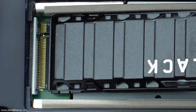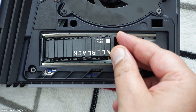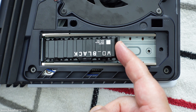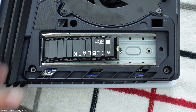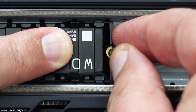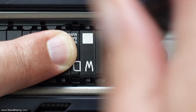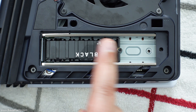Feed the SSD into the slot where the M.2 is and at some point you will feel it grip itself. Push it a little bit and you'll hear a slight click. If you let go of the SSD it will hold itself in place and become a bit springy — at this point the SSD is connected to the M.2 slot. Push down the SSD at the back, put the screw back into the spacer, and fasten it down tightly over the back of the SSD so it sits on top of the spacer and is held firmly in place.